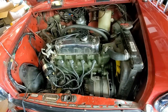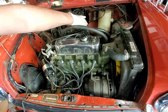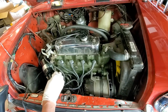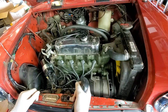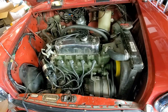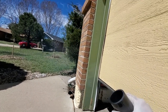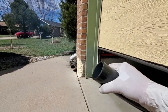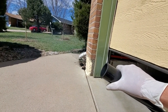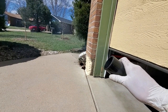I'm at the point where I can attempt to fire it up. I've done all the ignition work, the fuel pump swap, and corrected the choke mechanism — I've simply checked the basic settings. After reconnecting power to the coil it started and sounds pretty good, but unfortunately there's quite a bit of smoke at idle. I've adjusted the mixture for a good idle, but it doesn't want to rev and it's still smoking, so I need to diagnose this further.